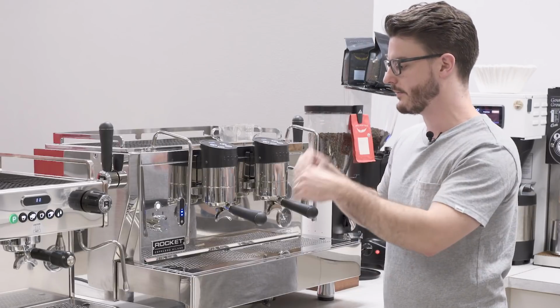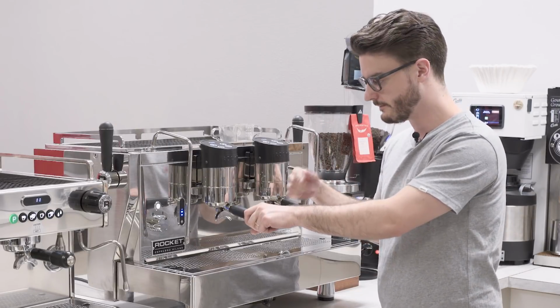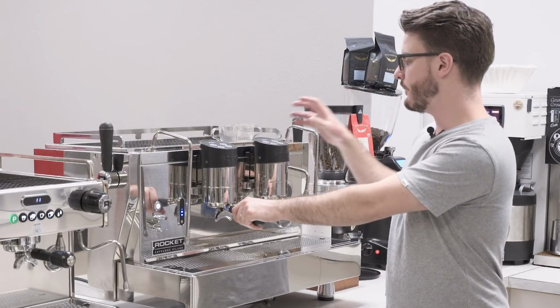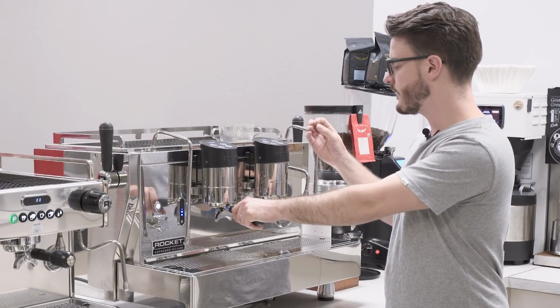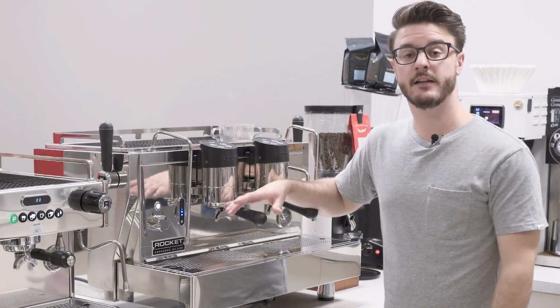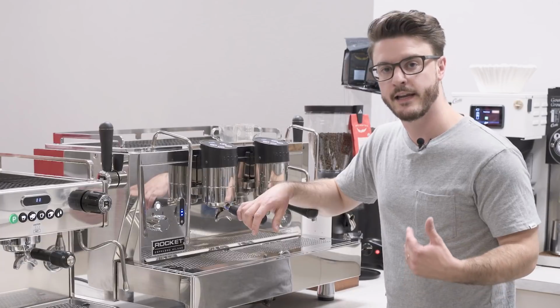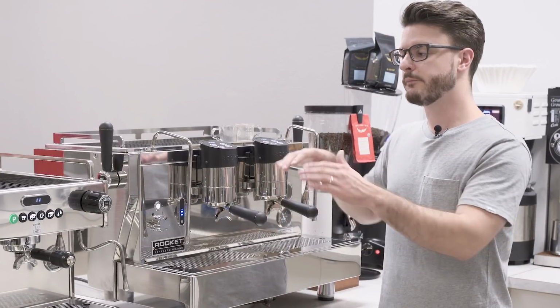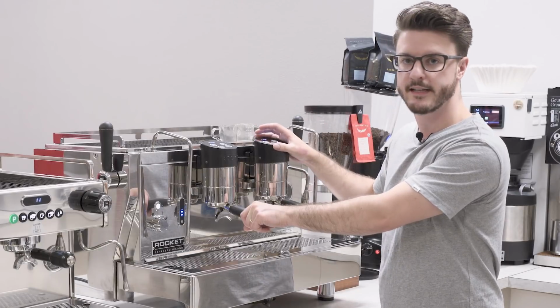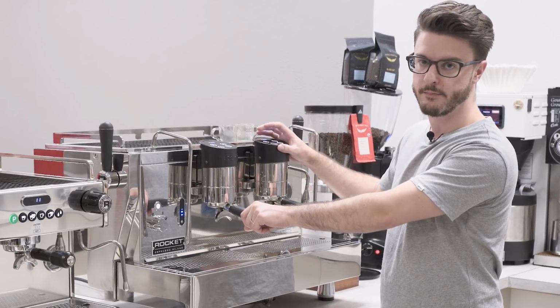And on most espresso machines, it's just filling with cold water. So that's dropping the temperature of that boiler. If I pull a shot and wait, and it fills a little bit and heats that, pull a shot, wait, fills a little bit and heats it, that's how I get good temperature stability. So in a coffee shop environment, both of these are going to have some pretty consistent temperatures, but the dual boiler design is going to have more consistent temperatures.